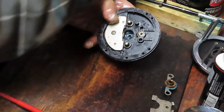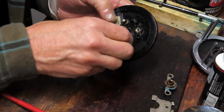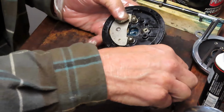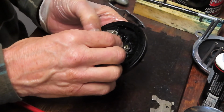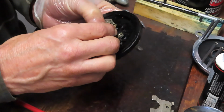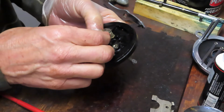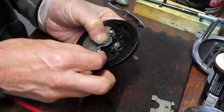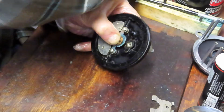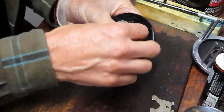Next up then, we want to go back and get those two very big springs. They ride over those collars there. Then we can get our yoke assembly, which we've already greased. Gotta press down on that, get everything to clear. Just like that. So you can see the slots. I'm going to grab our two smaller springs, which go in the upper cavity.